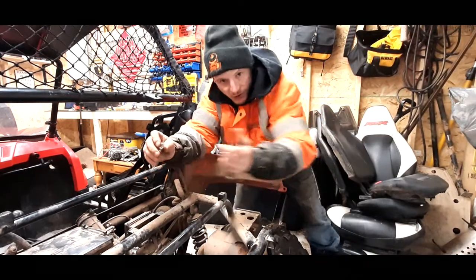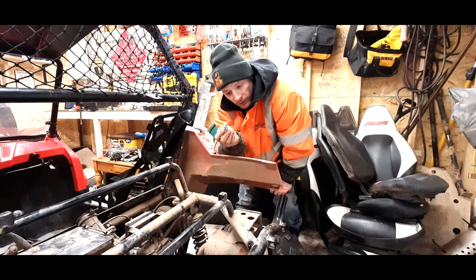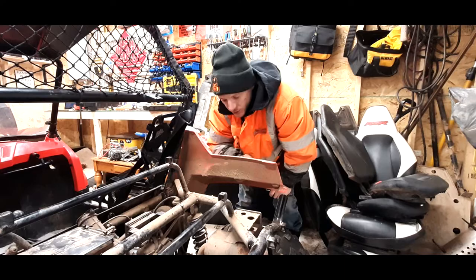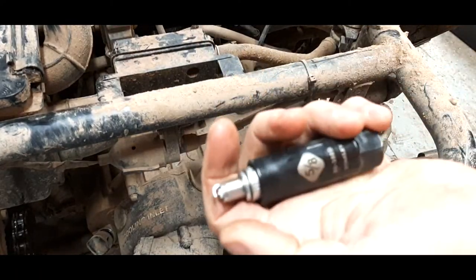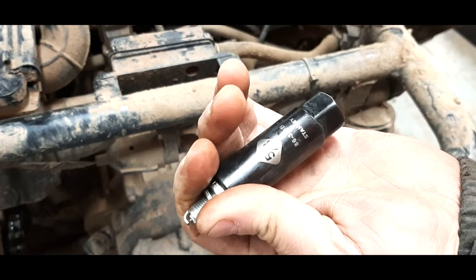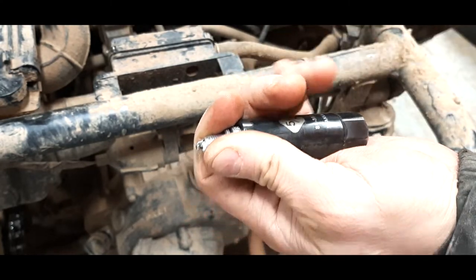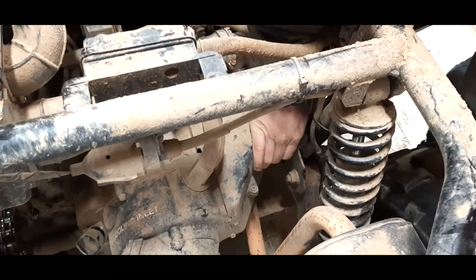But I mean, you just never know. Maybe at the factory, or on the way in shipping, the package was dropped and the spark plug gap got out of whack, and you always want to double check that, make sure. It'll make your life even easier. Because if you grab a 3/4 inch wrench, notice how the back of the spark plug, for odd, hard to get spaces, is made just for that. Finding the hole in the dark.